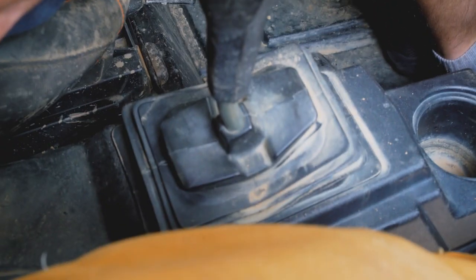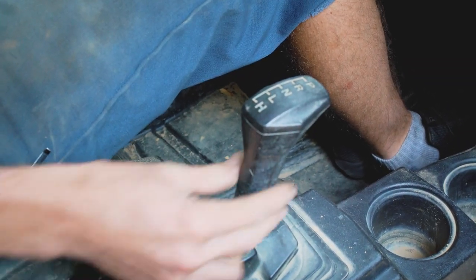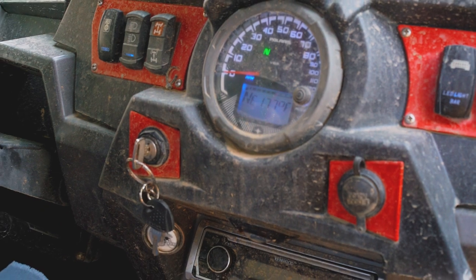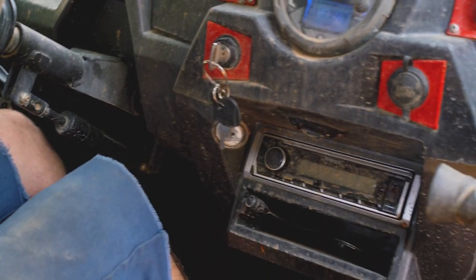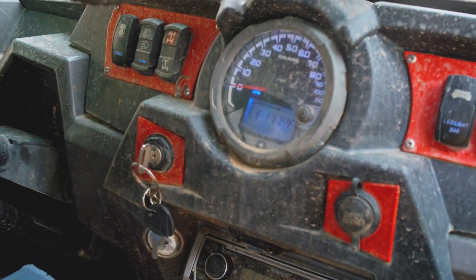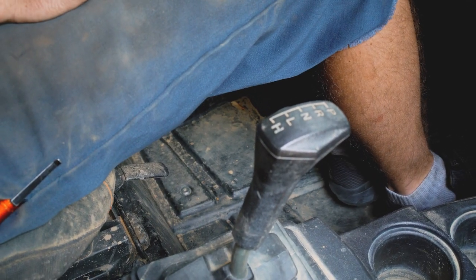So when you're on a hill, trying to back up or maneuver via the stock shifter is kind of a guess game, especially if you're trying to be in low and you're on a hill. You have to go from high, which is all the way down, up just a slight amount to go into low. So it shows we're in low on the dash, but just barely wiggling the shifter will actually change the gear indication with no actual physical input. I mean, we're in low there. Just barely bumped this with our finger, and now it's in neutral. So being able to have a positive, you know, I'm in low or I'm in a gear, period, is very critical in most situations. So we're gonna go put the machine in a predicament that's real life.